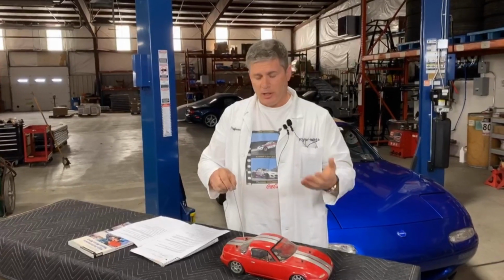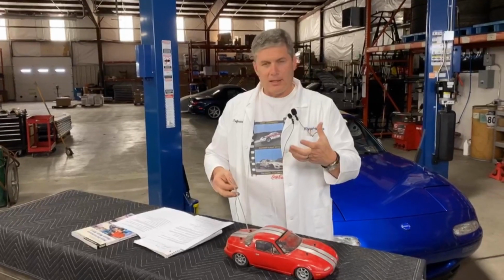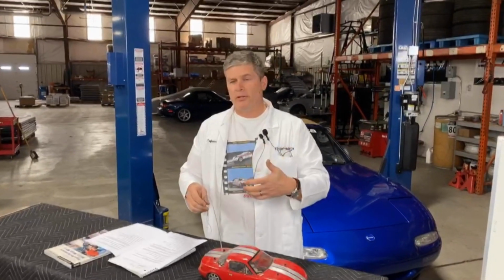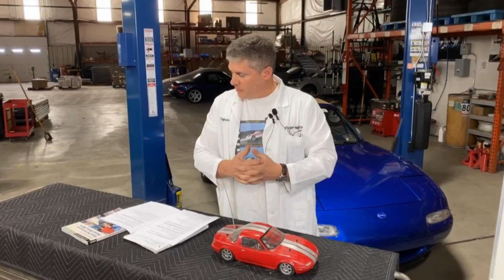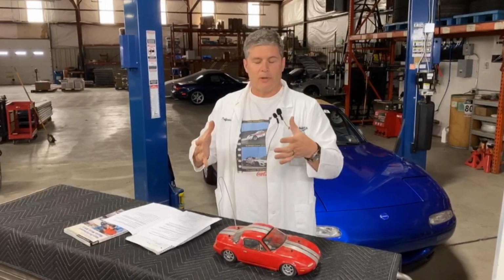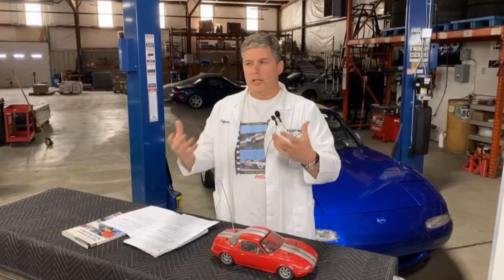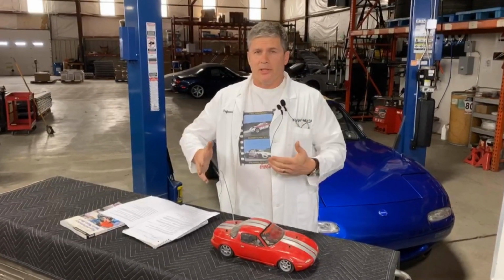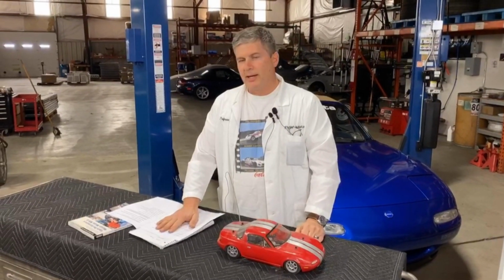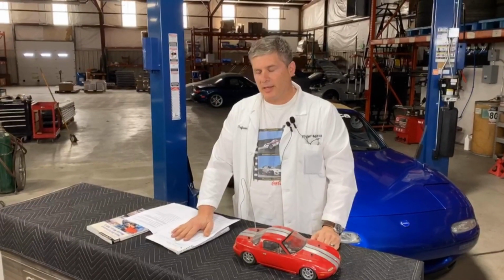If you're an autocrosser, you're probably going to want little 9-inch 1.6 brakes. If you're running on the racetrack and you have to use factory components, then yes, the 11-inch sport stuff for sure. The big brake kits have other attributes that we talked about earlier: the lighter calipers, the potentially stiffer calipers, the easier pad changes, the aluminum body to shed heat, that sort of thing. So they're both good answers. Generally speaking, though, you're going to keep the stock calipers if you're required by regulations. Otherwise, chances are you'll go to a different aftermarket caliper.